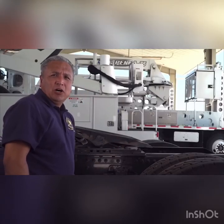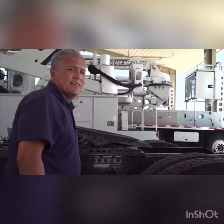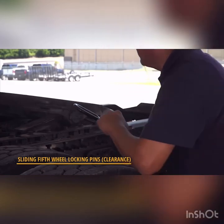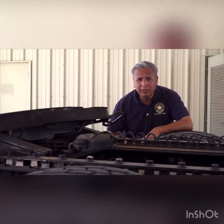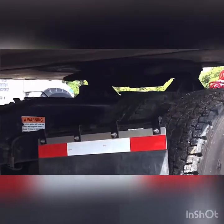Trucks, trailers, and tractor-truck combinations all utilize mounting bolts. If bolts are missing or loose, it could cause dangerous movement between the frame and the coupling assembly, and loose bolts could also snap off causing loss of the trailer. If the vehicle has a sliding fifth wheel, drivers will confirm there are no loose or missing pins; if it is air-powered, drivers will also inspect for leaks. The fifth wheel must be positioned so that the tractor frame will clear the landing gear during turns. The metal plate that attaches to the trailer and provides a resting surface is called the apron; make sure the visible part of the apron is not bent and has no cracks or breaks. The kingpin is necessary to attach the trailer to the tractor — any damage to the kingpin could cause the trailer to detach. Verify that the kingpin is not damaged and that the kingpin lock is in place.